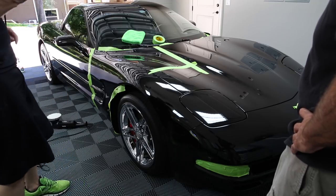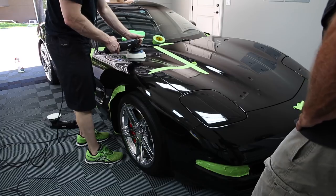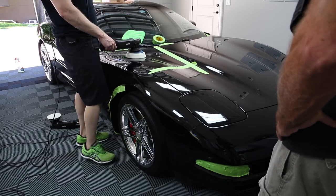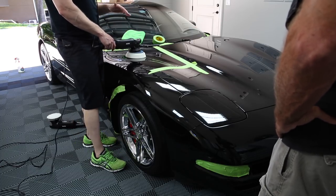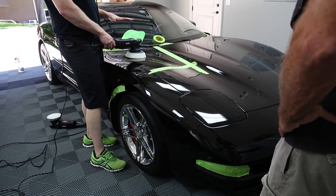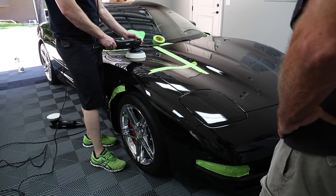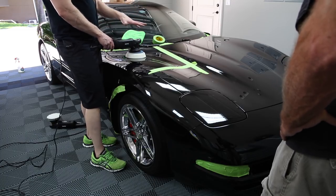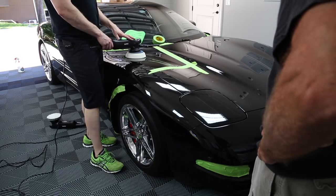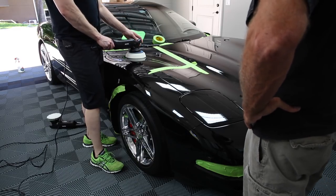And wow, that looks so much better. It's incredible. Now what this will do is jewel it. So now it's more important that I follow that pressure, pressure, pressure, a little less pressure, a little less pressure, and then almost removing pressure. I'll show you what I'm talking about. Because the 105 finishes okay, I probably only need to make about 5 passes, maybe 6.